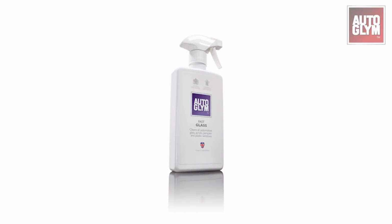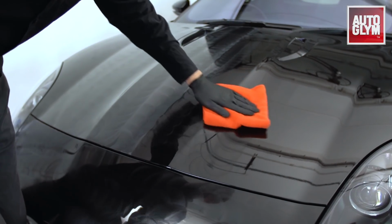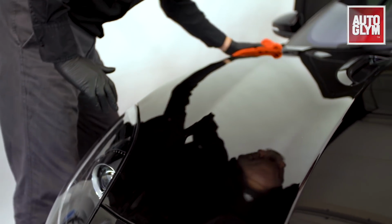If you do get wax on any unwanted areas, then fast glass is the best way to remove it. Leave the wax film to dry on the surface for 10 to 15 minutes and then buff to a high gloss with the supplied high-tech finishing cloth, turning it frequently during use. When applied correctly, UHD wax will not set hard or become difficult to remove.